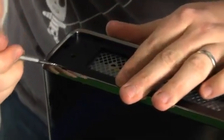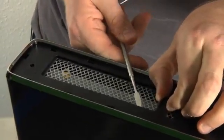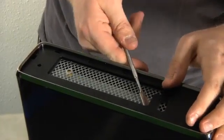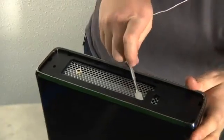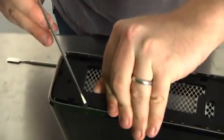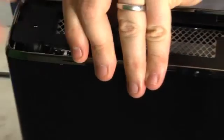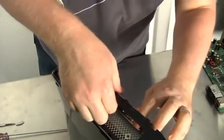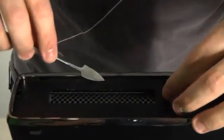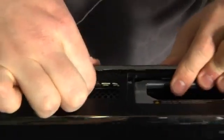It looks like it's holding into the plastic sides. I'm just popping it up underneath this edge on the inside. I'm gonna get a sturdier spudger and do some ever so gentle popping. This is definitely not designed to be user serviceable — not that we're really surprised. I got the first tab out. The tabs tuck in underneath the chromed edge of the 360, the kind of lower bezel for lack of a better term. I think I've given up on non-damaging approaches to this.